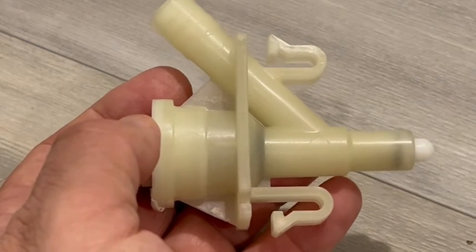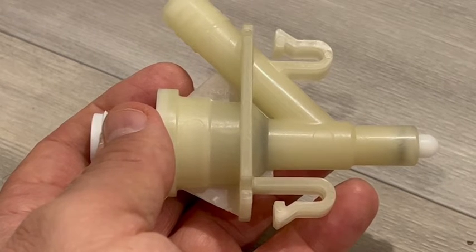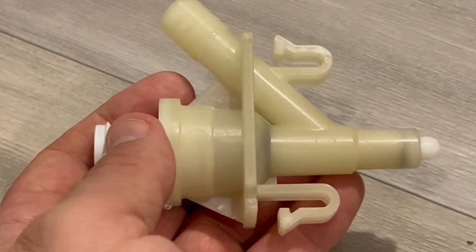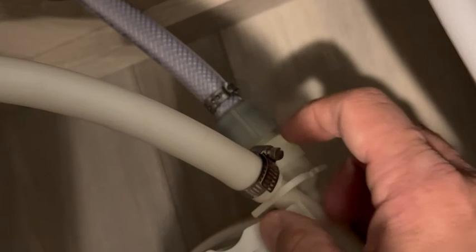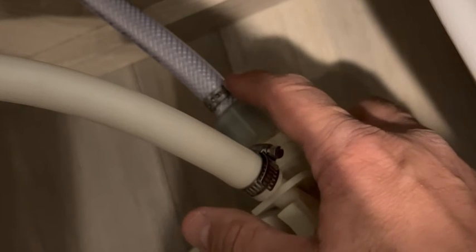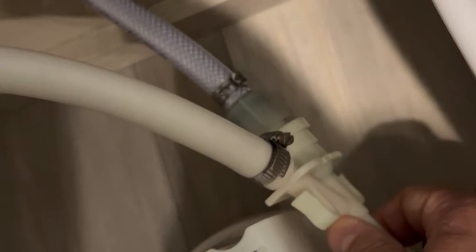I'm going to bring in a little closer to the new installed valve to show you the clamp that's on there. The reason for the diagonal cutters is to cut that clamp off and replace it with the worm gear clamp that comes with the new replacement valve. Here's a top view of the valve — these are the original factory style clamps. With your diagonal cutters, simply cut this part off and peel the clamp right off, then use the included worm gear clamp. It's just as simple as that.